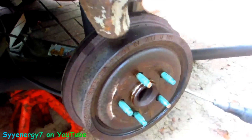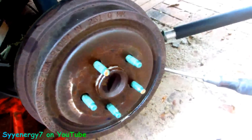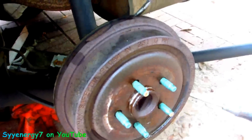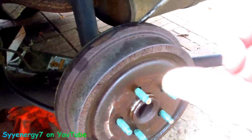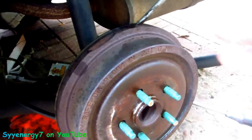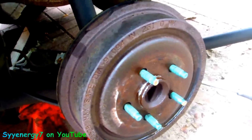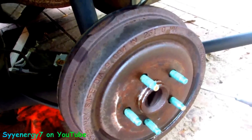You can tap it while you're putting the pressure on it, not too hard. I have an air hammer with a blunt round attachment - not the chisel, a blunt round thing - and I was going around here just tapping it with that, going all over the place. I figured that would shake it loose, I figured that'd be better than using a hammer. Even that didn't do it. The other side was maybe worse than this one. This seems to be moving a little bit better, but they're pretty bad. The air hammer trick is good.